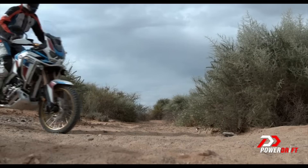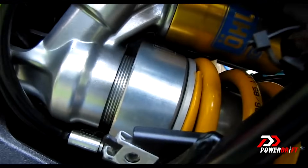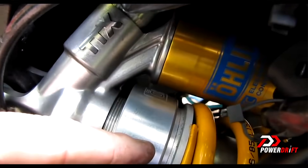If you have access to an electronically adjustable motorcycle, it's an amazing thing to watch preload at work. You can sit down on the motorcycle, set the preload, and see the motorcycle changing attitude. It immediately tells you that the attitude at which it was set — where the steering geometry works best — is part of the preload process, and if you don't do it, you won't enjoy the best form of it.